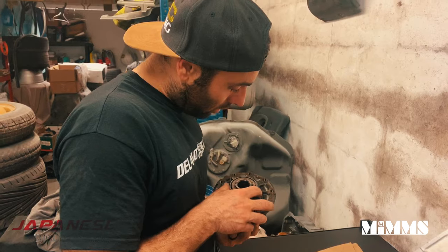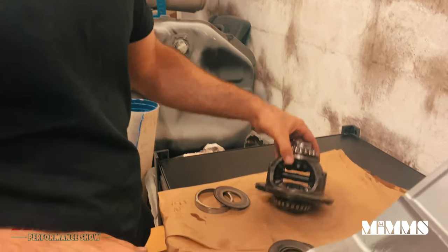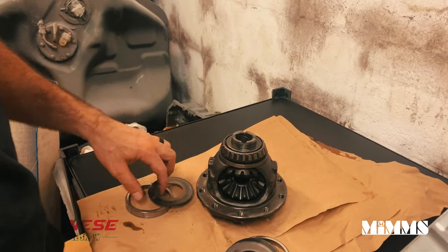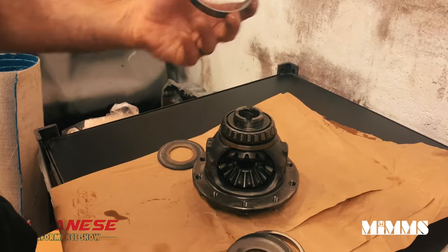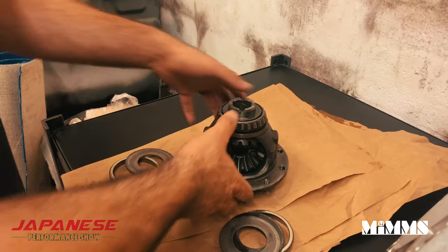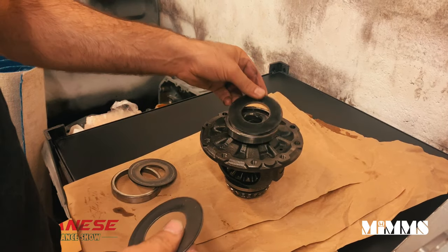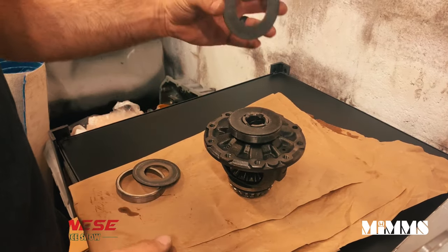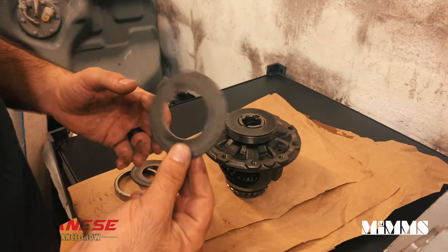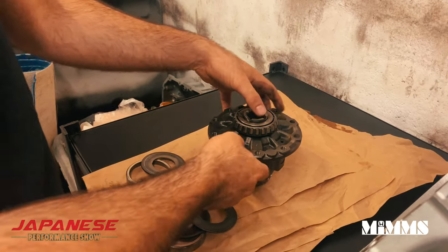The only thing we didn't mention in the early one in the video was this diff. The original open diff, this box had the old style open needle bearings, which actually sit like that. That part is inside the gearbox already. Got that sitting one end. Obviously on the top end, same again, but in order to shim it, you have this additional unit on the top. So you'd install everything and measure the clearance that you need and order one of these appropriate. So this has all been upgraded.